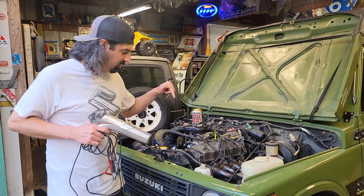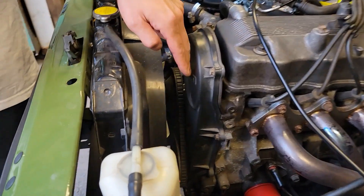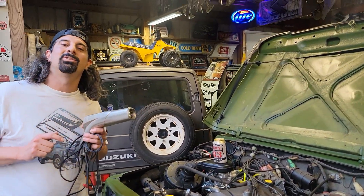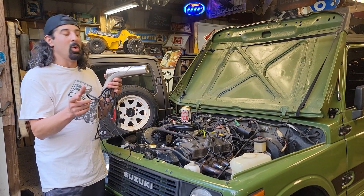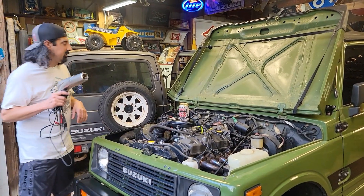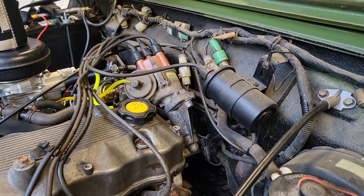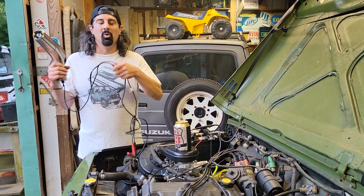What we are going to be doing is shooting the strobe light down onto your harmonic balancer crankshaft pulley. There will be a notch on your pulley — I have the notch marked with an orange marker so it's easier to see. There will be a section on the timing cover from zero degrees through 20, with increments in between. You want to line that up to 10 degrees, and how you're going to do that is by loosening the bolt on your distributor just enough to be able to rotate it.